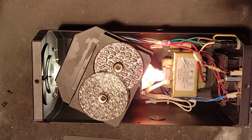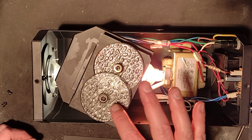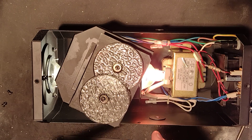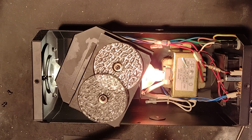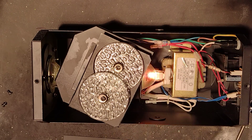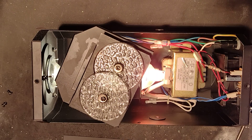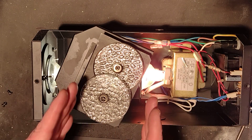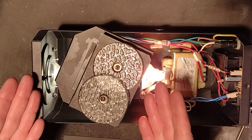So that's them lifted out of the unit so you can see them in greater detail. There is an earth bond onto them so I can move them. These are directional motors, although the motors themselves are marked CW and CCW — clockwise and counterclockwise. Usually when marked both ways it means it's non-directional, but these are directional. If I turn them off and on again you'll see they both go in the right direction, though they may jitter initially. Inside the motor there's a mechanism — if they start going the wrong direction it kicks them back until they can only freely go in one direction.